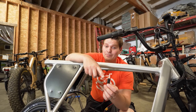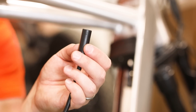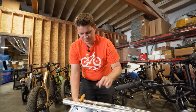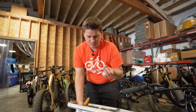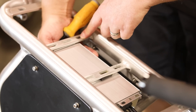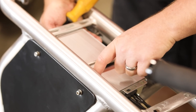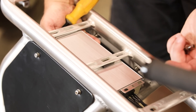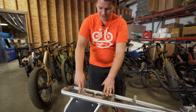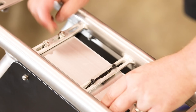For the motor plug, there is a small arrow on it — make sure you have the arrow on this plug and the other both lined up before you push those two together. Because the controller is bigger and doesn't fit in the box, we're going to mount it directly to the frame. We'll take a couple of the bolts and put them through the holes on the controller, lining it up with holes on the frame. For this prototype test we'll just put a couple of bolts in. I have the controller bolted on with those two bolts securely. Just to be safe, I went ahead and put a zip tie around the middle — that's not going anywhere.